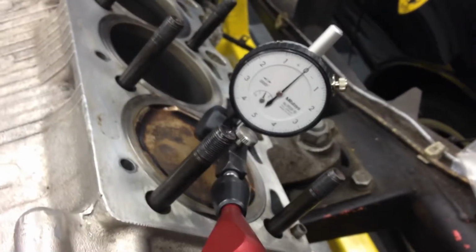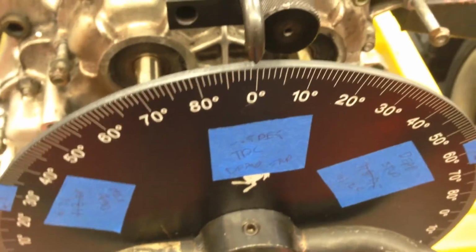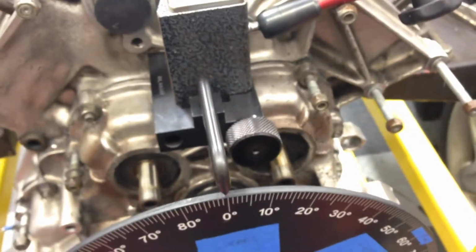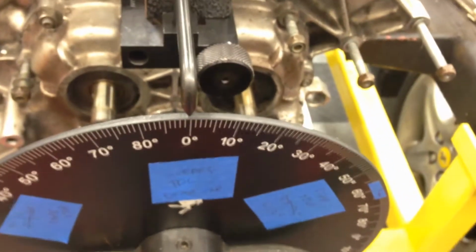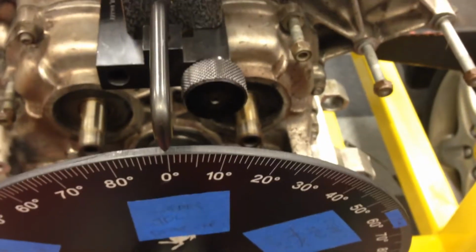But I've done this a few times, and I can't believe what I'm going to say, but this son of a gun, it's at minus 1/2 degree using the quote-unquote Ferrari method, where they record the indicator as soon as it stops motion. It's the same. Honestly, I can't do this with one hand here because I can't move the crank smoothly enough, and I don't have anything to hold the phone for this video. I did it before with a little selfie stick mounted, but I have nowhere to mount it right here. But it's the same. I can't believe I'm saying this, but you get the same result.